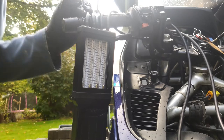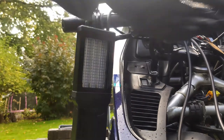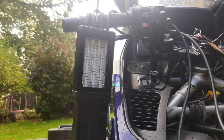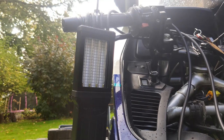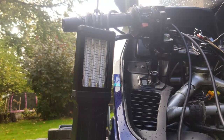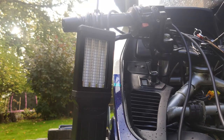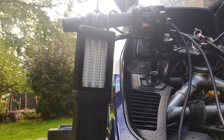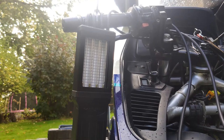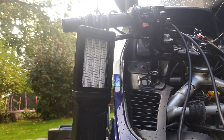It takes a bit of time, but once you get the hang of it, as I say, if your components are okay, it usually goes okay. It's not rocket science. Fine tune the whole time, and then sometimes you have to adjust the tick over, perhaps, but it all depends how your pilot jets are.